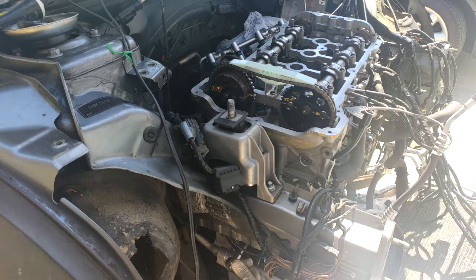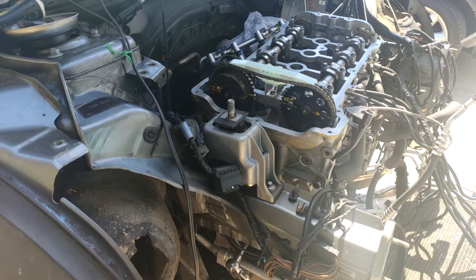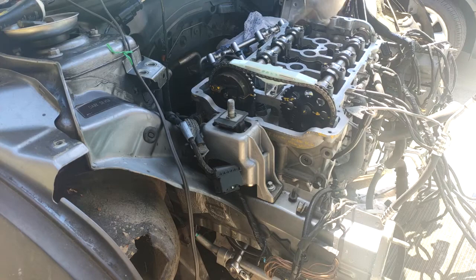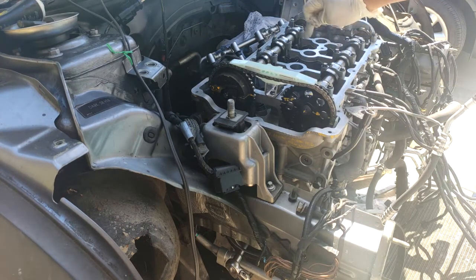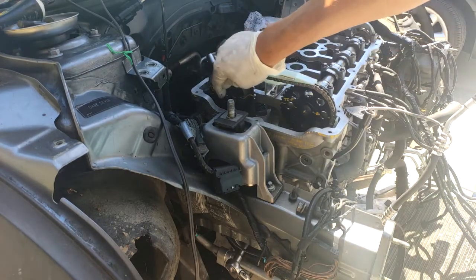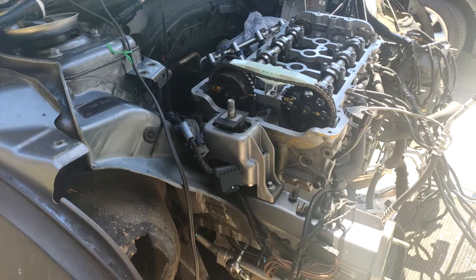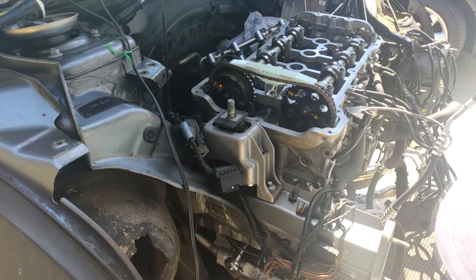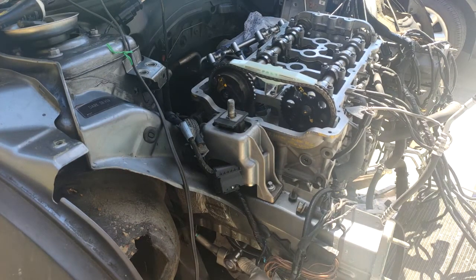That's one full rotation and we are back on time — as you can see, the lines there have the top edges flat on the back and the writing is on top on the camshafts again. Let's turn it one more time. I'm just afraid of this bolt though, because that's a torque-to-yield bolt and once you stretch them they don't have much more elasticity left.